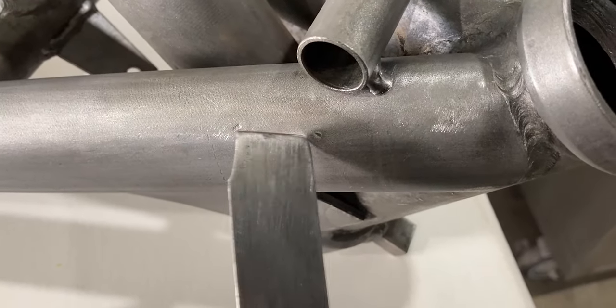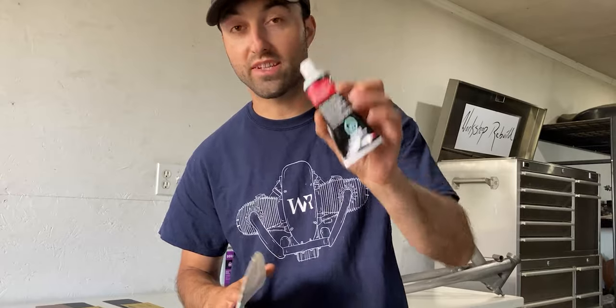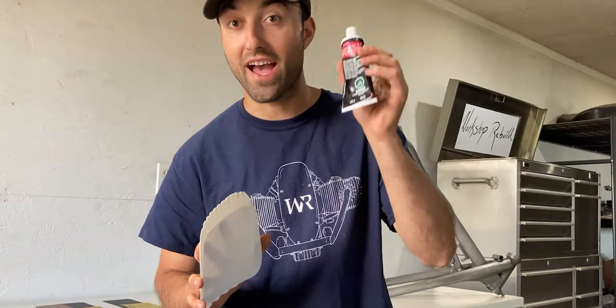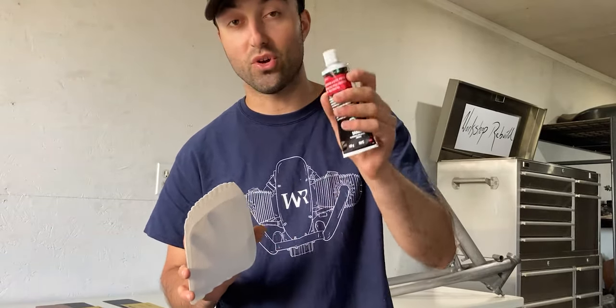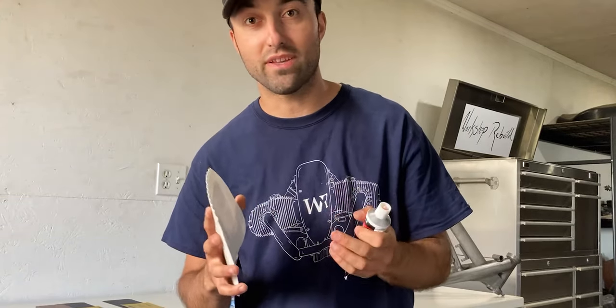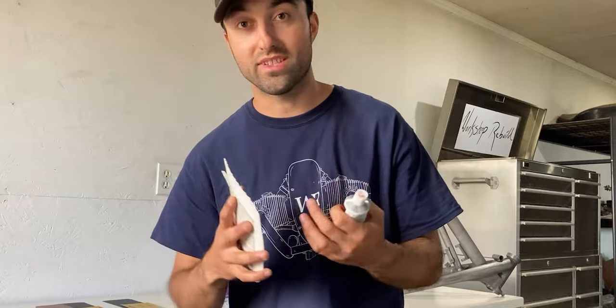I found all the imperfections on that motorcycle frame. Now I'll grab my glazing putty, smear a little bit onto this plastic surface, and mix it up — because these tubes can be sitting for a long time at the hardware store. Then I'll apply it and wait around 25 to 30 minutes. Once it's cured I can sand it down. Before applying the glazing putty I'll go ahead and grab my acetone to degrease and clean the surface so that the glazing putty will bond properly to the metal.